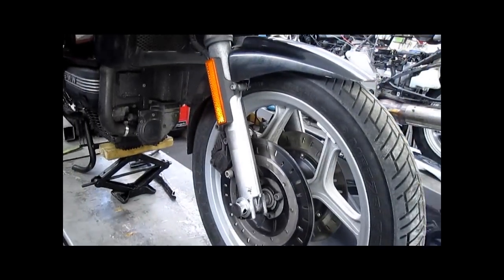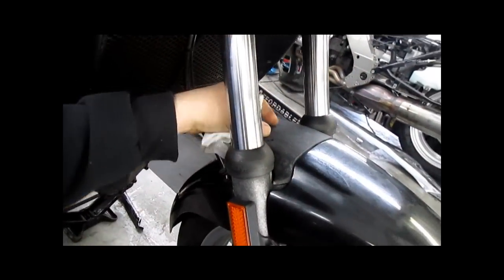And out with that, the front fender comes off. There's a little trap door here on the back. You just peel it back. You'll see an Allen bolt right here, 5mm Allen. We'll remove that. That will lift the top cover. No, it doesn't. That just separates. That's going to be a long through bolt on the K75. So anyway, use an Allen wrench, take that bolt out.